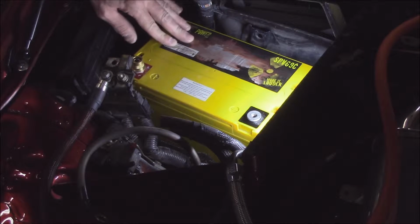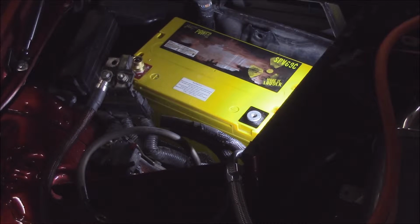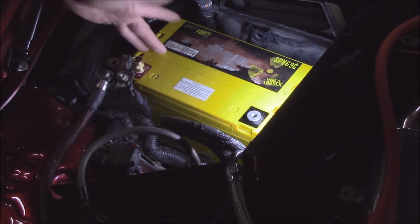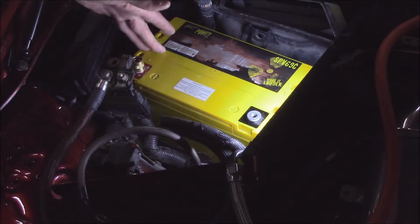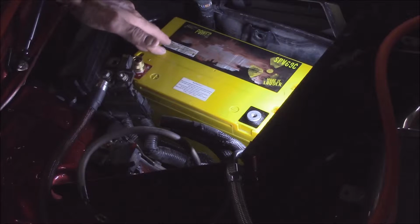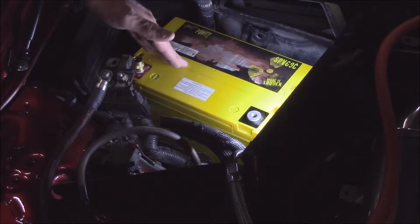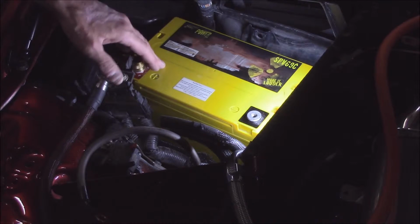What's nice about these kinds of batteries is the ability for them to deliver their power with a very low internal resistance inside of it. It's able to discharge at a very high rate. Just a couple of specifications according to Stinger's own website: it says that on a 20-hour rate it'll do 3.45 amps, 69 amp hours. So we're able to deliver a lot of current over a long duration before we get down to the plate voltage itself.